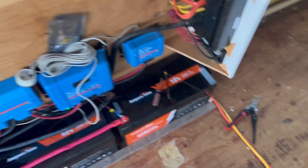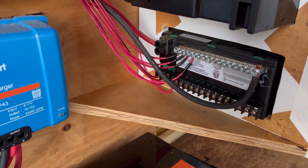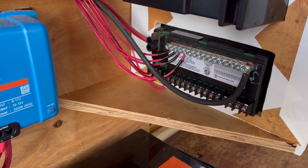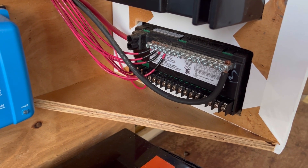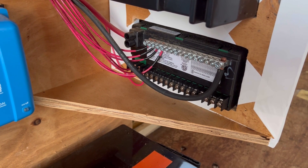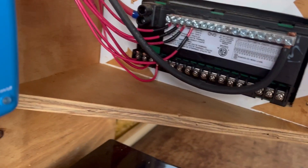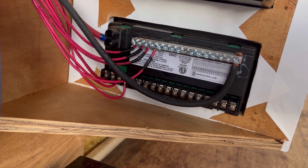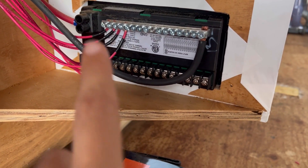So I'm in the middle of doing my DC wiring. I kind of got started because I wasn't sure exactly how it was going to go, but you're seeing a sea of red wires over here and that is because I am cheap, so I bought all red wire and I'm just putting black electrical tape on either end to signify which wire is which as I'm running them. I know this is not the best way to do this — I know that there could be problems if I need to work on the middle of a wire and I'm not sure whether it's the negative or the positive. There are ways to test that, but I know it's making more work for myself if anything should ever happen. That being said, I need to double check my wiring on the back of this fuse box because I noticed on one of Explorers.Life's videos that when he started putting the positives in at this end, he would put the corresponding negative all the way over here. So I have to double check and make sure that's not what I'm supposed to be doing before I actually hook items up to this.